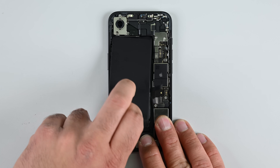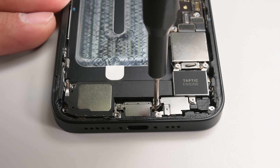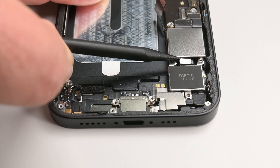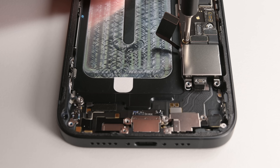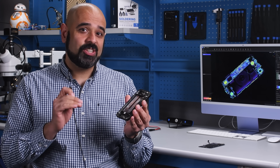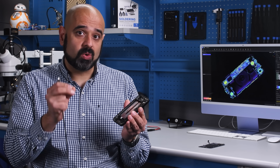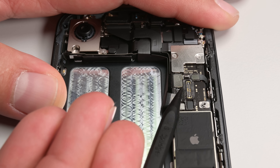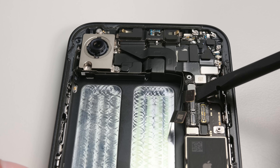With the battery out, I'm going to start disassembling the lower portion of the phone and make my way up, starting with the lower speaker. As I'm removing the Taptic Engine and the SIM card space holder — which, by the way, is a wasted portion of space in US eSIM-only phones — I realized that the USB-C port removal process that saw significant simplification in the 16 Pro and Pro Max has regressed in this iPhone 16e. This is partly because the iPhone 16e shares the same architecture as the iPhone 14, but it's still disappointing to see. This component has always been a pain to remove in almost all iPhone models, and for a component with high mechanical wear, that is a problem. Now the SIM card placeholder has a single bracket that's trapped underneath the logic board, so I'll need to remove the logic board first. It's possible to slide the bracket out by bending the logic board just a little bit, but it's not something I'd recommend doing.